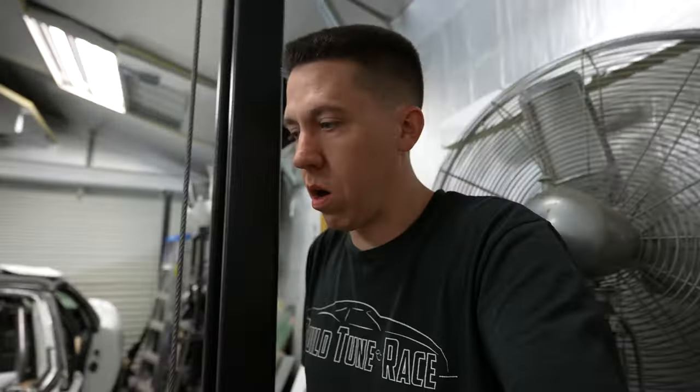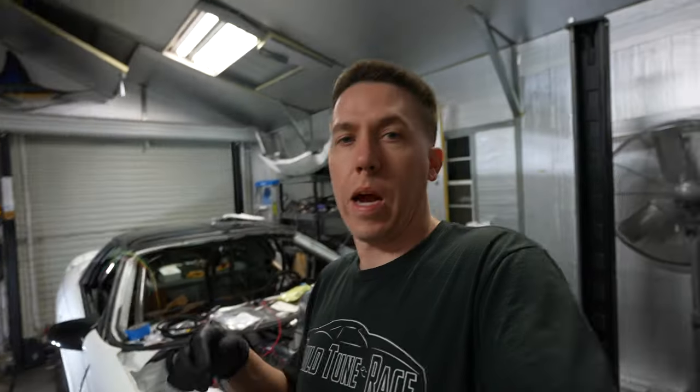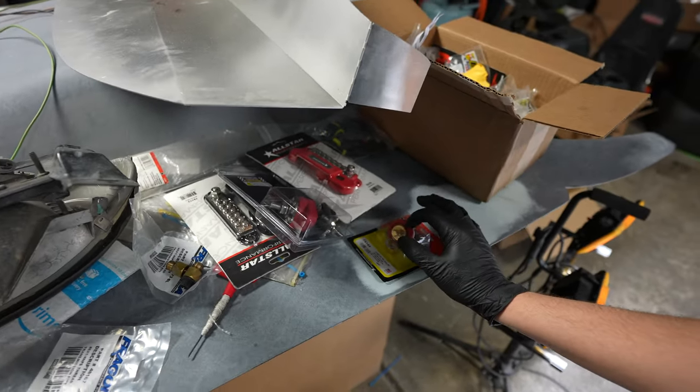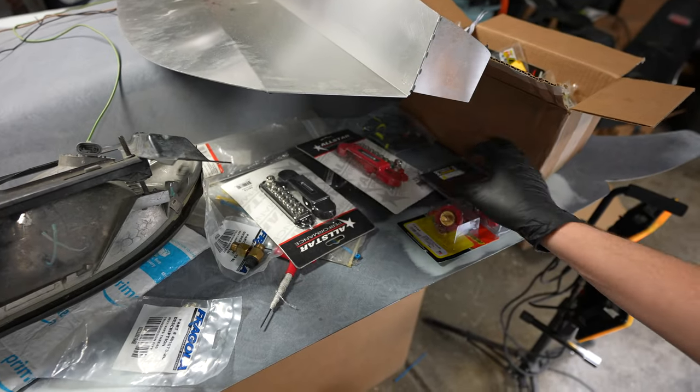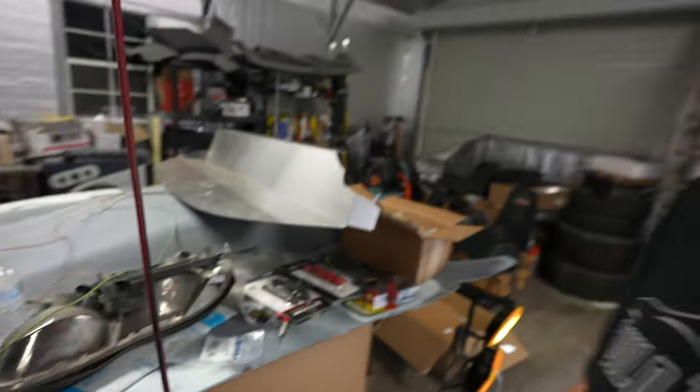Like I mentioned, it's just a bunch of little things — I'm just working around on the car. Something I want to do now is try to pop out the heater core block-off panel and start putting all my wiring studs there. I have the starter stud that goes through the firewall into the engine bay, distribution blocks for ground and power, and also 5-volt ground and sensor ground out of the Holley, so I have my distribution blocks for sensors. The wiring approach is to put things in place first, then hook everything up — it almost helps to see it from the end and work it backwards.